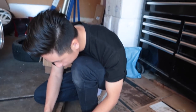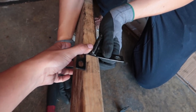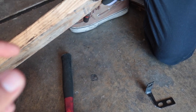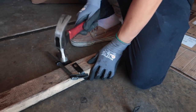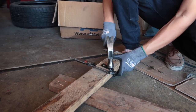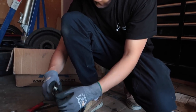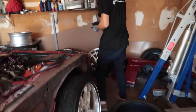I was wondering what was touching me — it was a damn fly. Flies aren't welcome in this house. So you're basically going to clamp this down with the line matched up to the edge, and at this point all you do is just bend it — bend it and send it. After you get it to this side of the bend, take a hammer at it to make sure you have a straight bend.